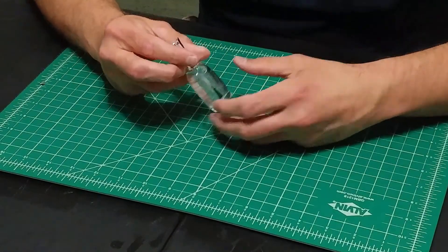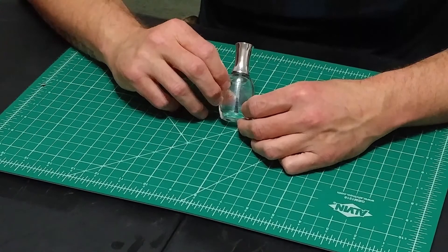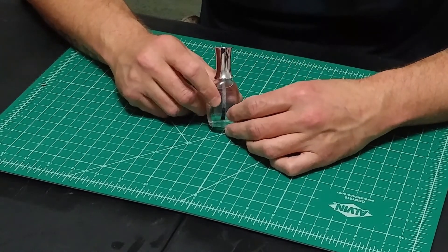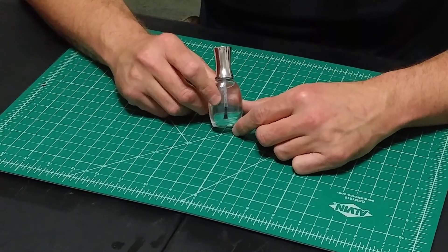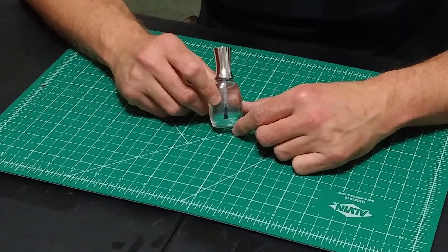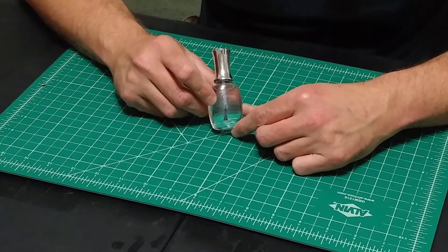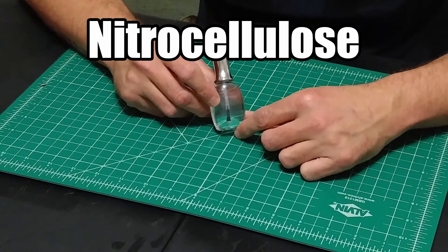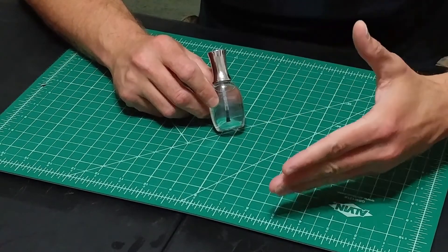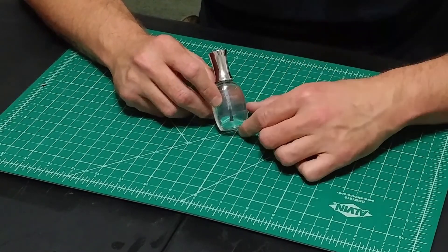That brings us to fingernail polish. To protect your CPU from liquid metal, you're going to want something to coat sensitive spots on the CPU PCB from possible liquid metal spillover. For that I'm using fingernail polish. There are other products available for this, though I went with fingernail polish because it looked easy to apply and my old lady already had some on hand. For the fingernail polish, you're looking for specific ingredients called nitrocellulose. I'll leave an Amazon affiliate link to some suggested fingernail polishes, though I personally suggest you just go to somewhere like Walmart and pick one of these bottles up for like three or four bucks.